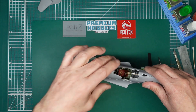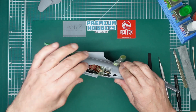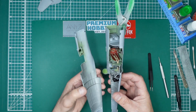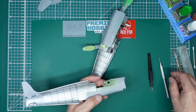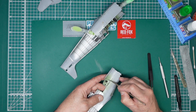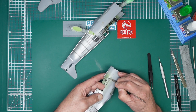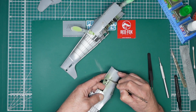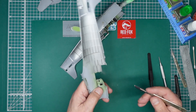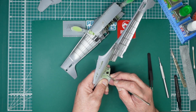Everything is closing up lovely — the extra time spent is so worth it. We've got a lovely seam down there, a lovely seam here, and a fine seam at the front that'll need a bit of filler. I may need to remove some paint from that groove to allow this to close up a bit more — just scraping some paint away from in here. Remember we've got a lot of paint and clears in there. We need to make sure we don't let that knife jump out and scratch the lovely green paint on the side wall.